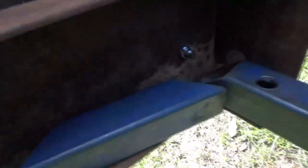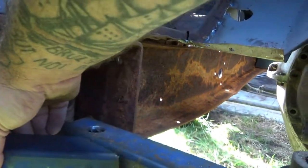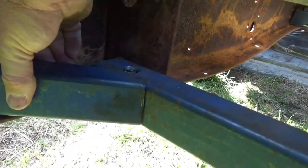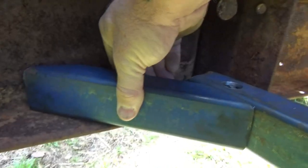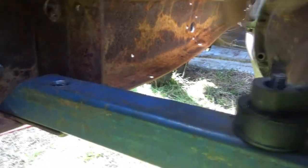I'm going to leave the cab on for now because I'm not going to have enough room moving it back. So what I'm thinking of doing is — I've got these pieces cut from something else I had laying around — putting that there, welding it to the original crossmember and then bolting it to the chassis over there. That will give me torsional strength because at the moment we've only got up and down strength. With the front end connected to this crossmember, we need it to not twist — so that's going to give us that strength.